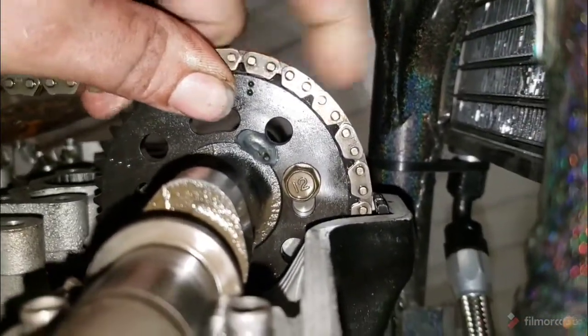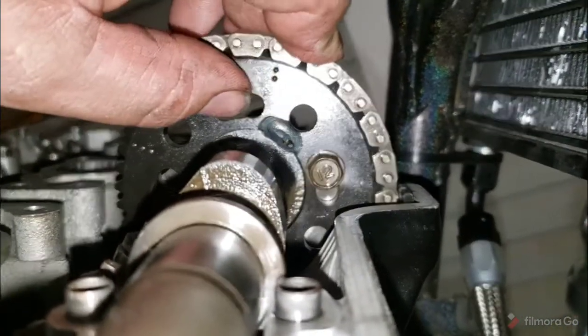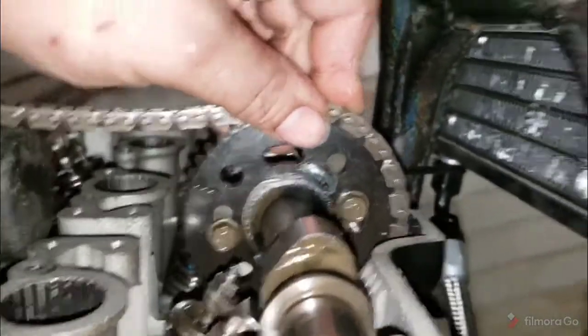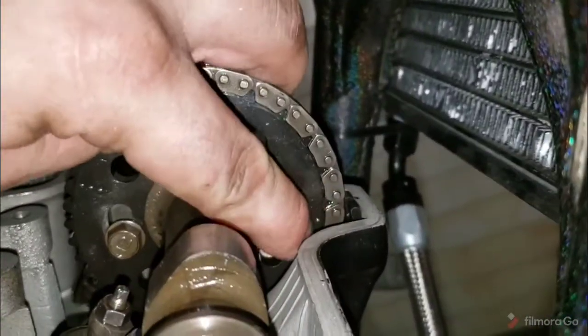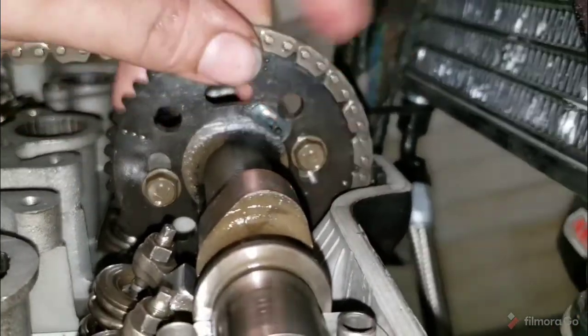Right, number one's there, it's the top of the tooth, it's the smack center of the sprocket, see what I mean? Okay, it looks a little sub-level from this angle, but it's level. The angle's going to deceive you, it may appear to be slightly below, but it's better than being above, because above means your cam timing is wrong.